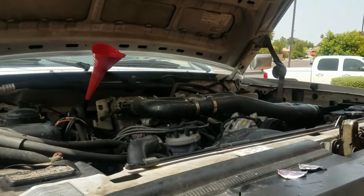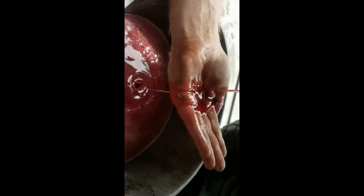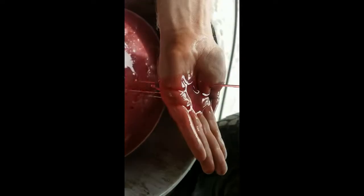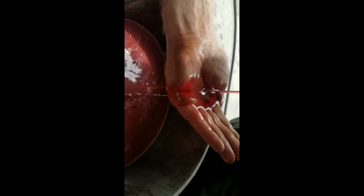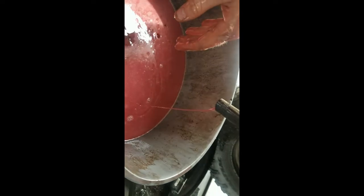We've run about five and a half to six gallons through it, and you can see now it's running pretty much like fresh brand new trans fluid. Hopefully there was minimal damage to the transmission from that coolant and Max Life mix, but we're not going to find out long-term right now. The trans already still shifts good — wish me luck on this one.